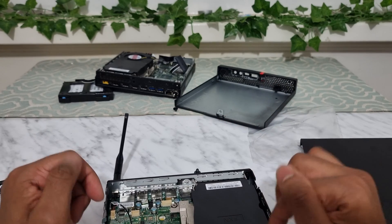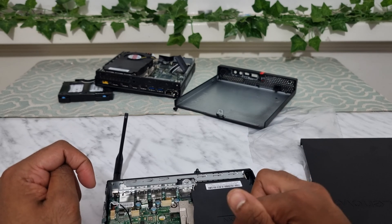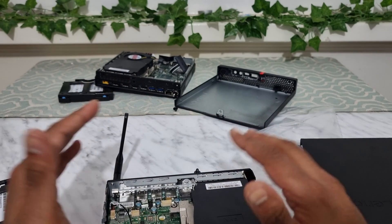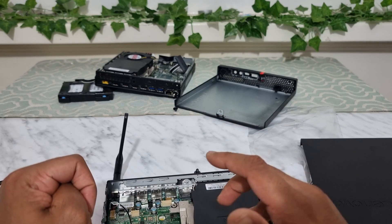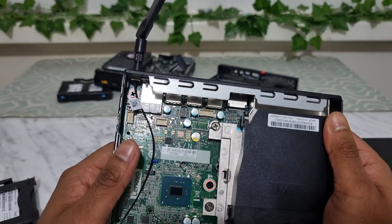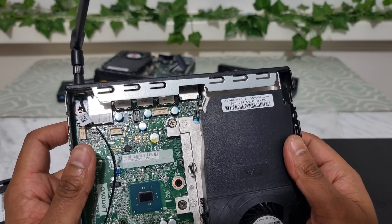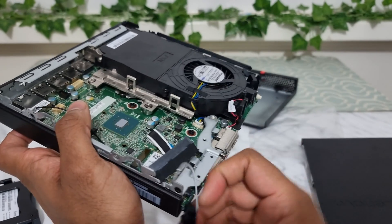I hope you enjoyed that video. If you have any questions, message us on eBay or leave a comment below — eBay should get a faster response. Also, always take precautions: if you have an anti-static bracelet, use it. If you don't, make sure you discharge static electricity by touching the metal parts so static doesn't kill the components inside. Also, do not have the machine plugged in — if it was plugged in, unplug it and hold the power button for 10 seconds to make sure all power is drained.